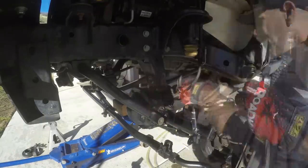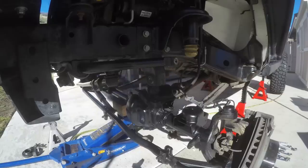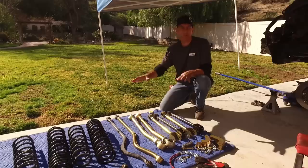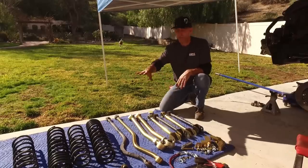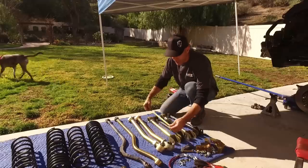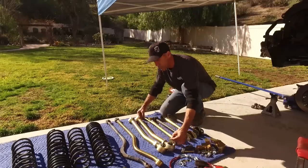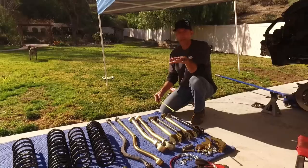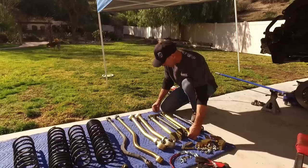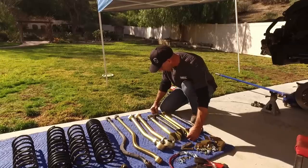I took a few minutes to clean up the front axle and surrounding areas, and then I removed the upper control arms for a little show-and-tell session. I always love to do this side-by-side comparison — you can definitely see how much beefier the MetalCloak stuff is than the stock, and this is the Rubicon stuff, so it's an upgrade from the normal Wrangler. What you want to do before you install this is measure the eyelet-to-eyelet distance. MetalCloak wants you to put that at 18 and three-quarter inches because you're changing your caster angle — as you raise the Jeep they want five degrees of caster in there so it handles better for the added ride height. These came shipped at 18 and three-quarter, so it's just time to install them.